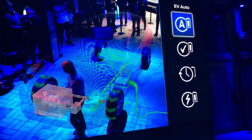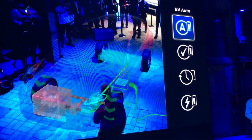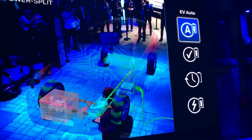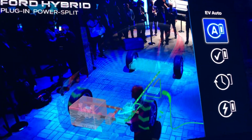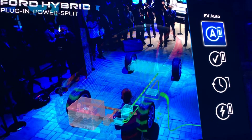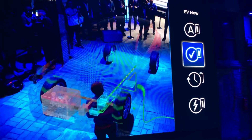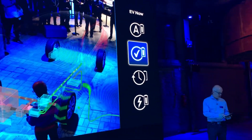And you can maximize the benefits of the powertrain by using the selectable EV modes. In default auto mode, the Kuga drives electrically for as long as the battery state of charge allows. And when it drops below around 30%, the Kuga becomes a self-charging hybrid. So even after 50 kilometers or so, you still have the great fuel economy of the full hybrid, giving you an emission-free, electric-only driving experience as long as the battery is sufficiently charged.